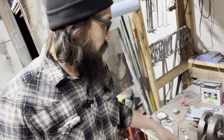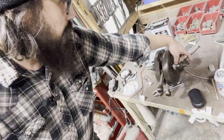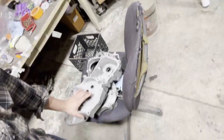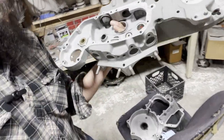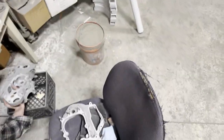Flywheels for the iron head are here. Here's the old Timken bearing and the spacer; the new one is in the box. But before I can do anything on that, I've got a couple things to prep on these cases. On the cases I have one cam bearing kind of slightly rested in there — figured I'd come up here, press those in, and then same thing on the crank.